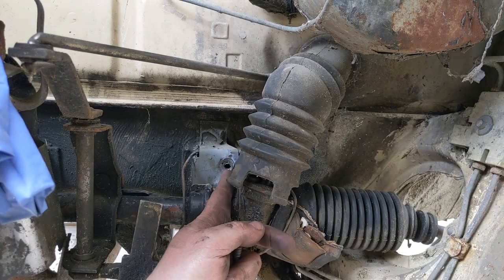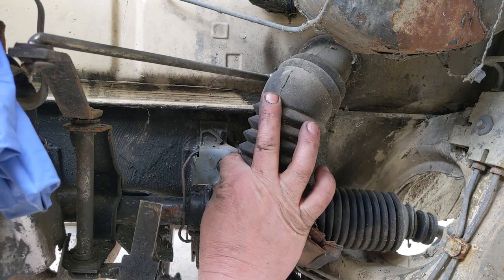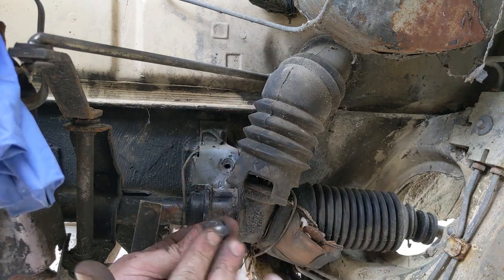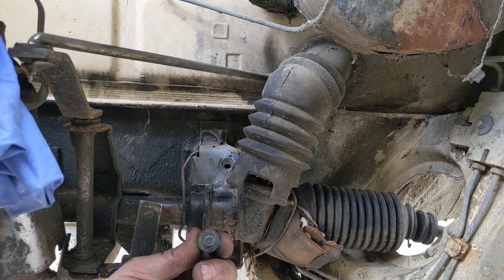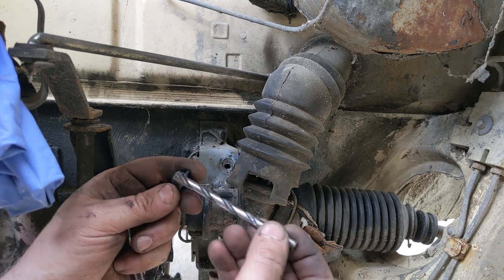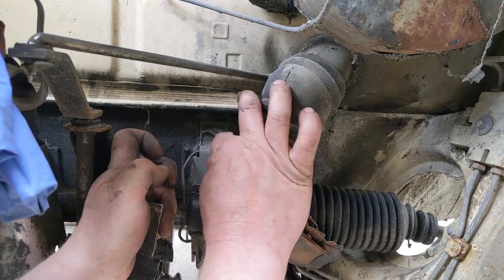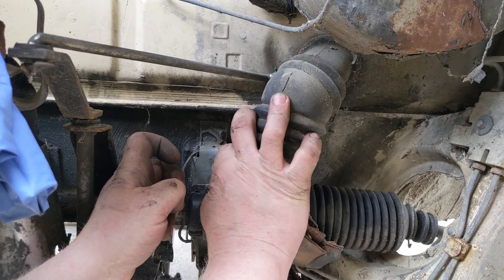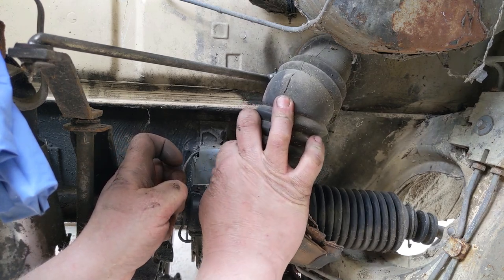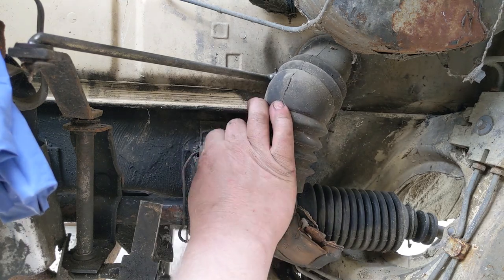So this top bolt, it's actually a captive bolt behind. So it's a bolt like this behind this plate that I can't get to with the head sheared off. So the head's still there. It doesn't move at all. It's nice and sturdy. So I drilled through it and just tapped it. And so now the head of the bolt is now a nut for this 5/16. It's not metric, putting a standard bolt in there, but that goes in there nice now.